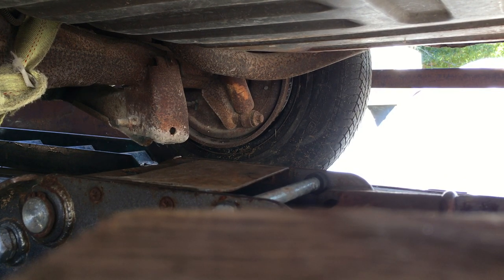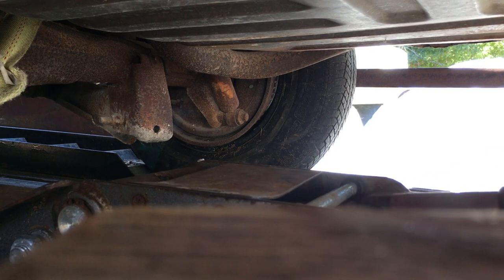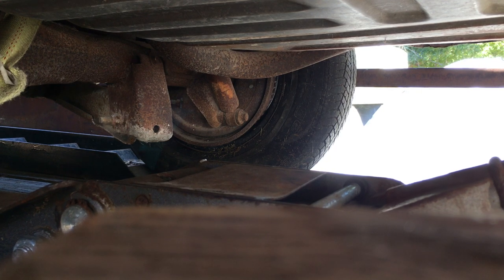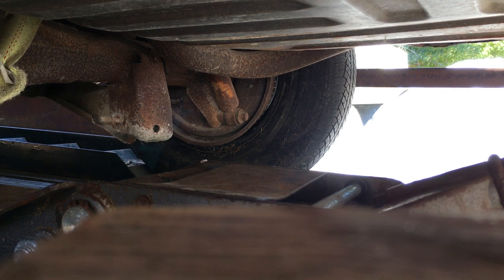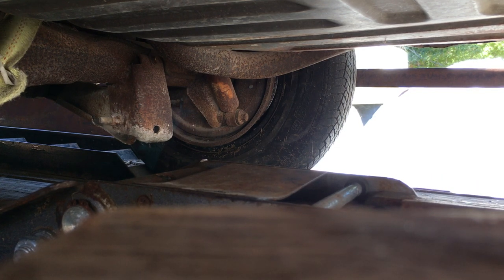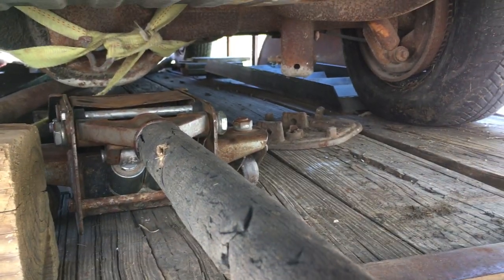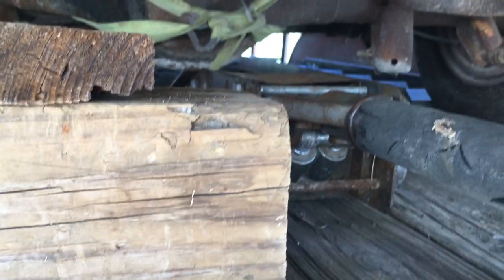I'm going to leave the jack in place and just put it back in tightening mode and just put a tiny bit — I don't want pressure on it. All I really have to do is have the jack under the differential in case this thing goes. And I don't want this handle to go up in the air again, so I'm going to put the weight of the pipe wrench on it. It seems like when I twist the release to get the jack out, this handle wants to go straight up in the air. And I really want to make sure that that tire holds the weight of this car. So, that's enough of that. Thanks for watching.